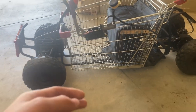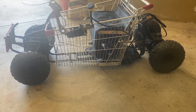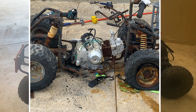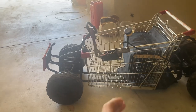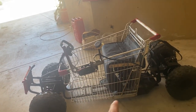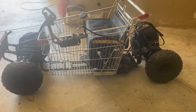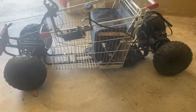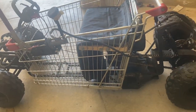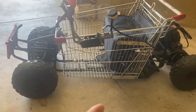I recommend people to get an old scrap quad - I'll show you what I started off with in the photo I've just put on the screen. Basically you cut the top of the quad out, cut all the little scrap bits that go in a bend, then you cut the quad in half. You extend it out and put all those little scrap bits from the top down the center of it - that makes it long, and that's where you get the length for the trolley to sit in. Once the frame is built and welded together, you want to add little structural metal bits down the middle that stop the frame from bending. I had a problem where without those the frame would just snap.